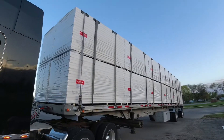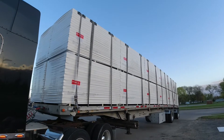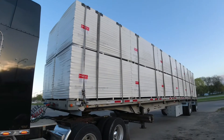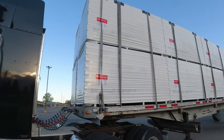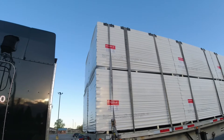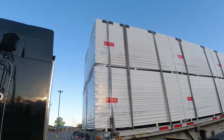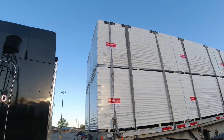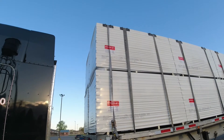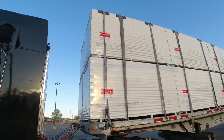Hello YouTube, hello subscribers, hello friends and family. This is an instructional video on how to secure insulation. You need two straps within the first five feet, and this two-inch strap very close to the front is very important — the wind will tear up the insulation if you don't have it. Make sure to get one two-inch strap closest to the front of the load, so two load securement devices within the first five feet.